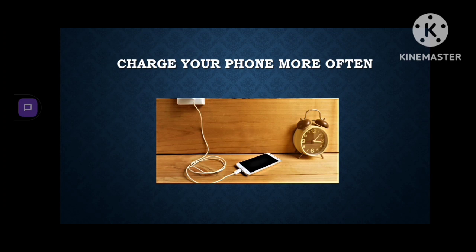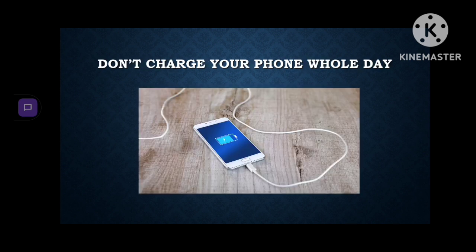When you charge your phone more often it will just increase the charging cycles of your phone. Usually a phone has 400 to 600 cycles. If you drop it to zero every day it will just last 400 to 600 days. When you charge it when it is at 20 to 40 percent it will last till 1000 to 1100 days.